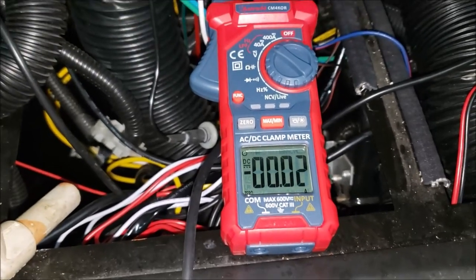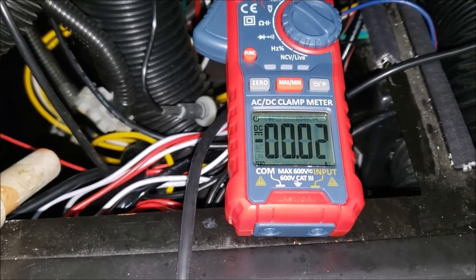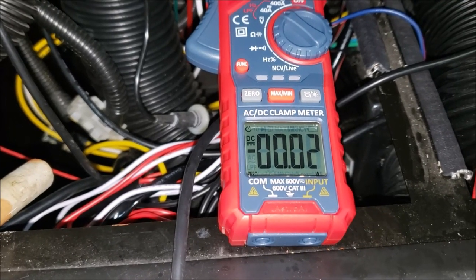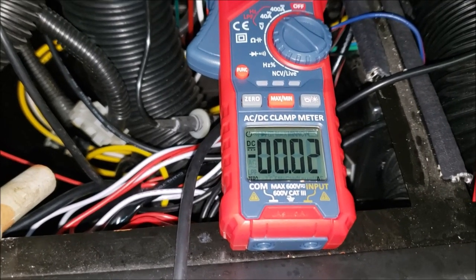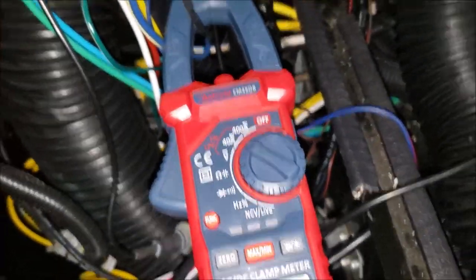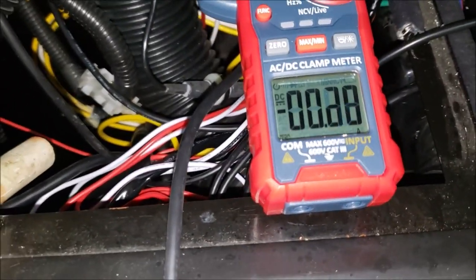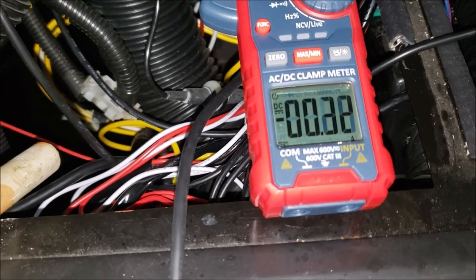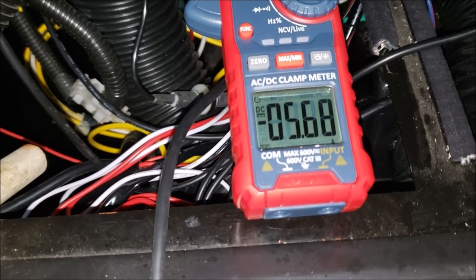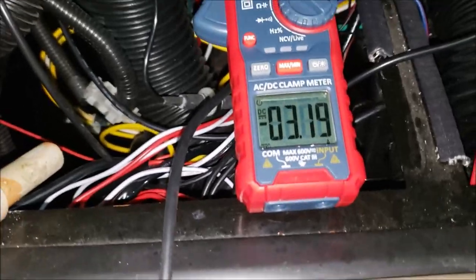So I guess they have one wire that controls the fan when it's on high, and then another wire that controls the fan at anything but high — through the lower speeds. So let's go to our next wire. Here's our last wire, the black one. Notice on high we don't get much amp draw at all, but drop it down to the next speed and we've got 9 amps, then 5 amps, then it drops on down. That kind of makes sense — that's why they're doing it that way.